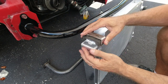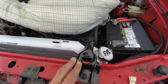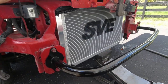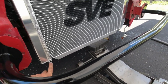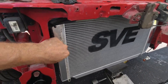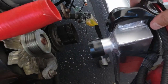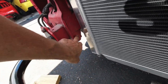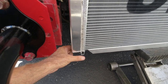I can use the upper mounts and then be able to locate where the bottom should be, and that'll help us determine what height we need to get that bar to weld it in place. I installed the upper mounts with the rubber in there and squared it — that's looking like a good fitment. I can't put the bar down below the lower radiator piece because the jack's in the way. So my idea now is the jack has it held in place, the brackets are locating it for its position. I'm probably going to drop some nylon rope string through here and tie it up so it's essentially hanging from these to locate it, and then I can pull the jack out and start test fitting the bar up and cutting down these sides. Since I'm welding the perches on that bar that goes under here, I get a little bit of leeway with how I weld them on there.